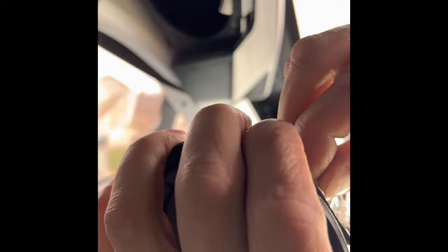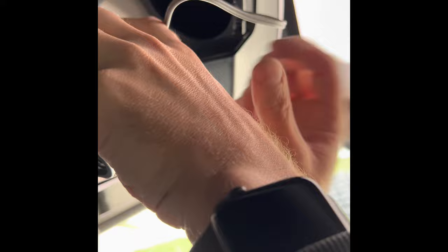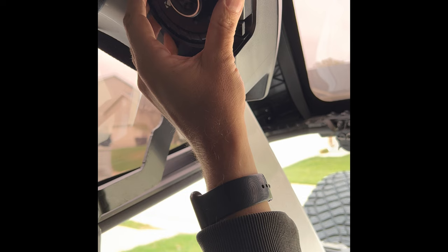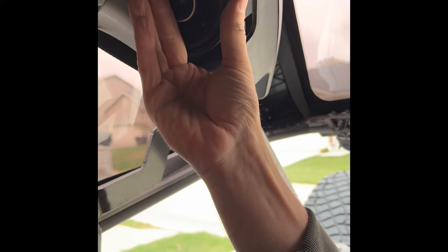I'm going to stick these up in here. This is temporary — I know this is not the right way to do the wiring. If I can't find adapters that'll work I will just cut them and solder it together. In my old truck I used for four-wheeling, my Xterra, I soldered every connection for the stereo together because after a couple years of four-wheeling you really start to rattle everything loose. Nothing sucks more than being stuck in a radio just because you're too lazy to solder a couple wires together. I just want to try and find the factory adapters first.